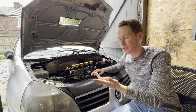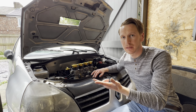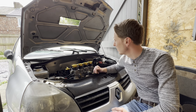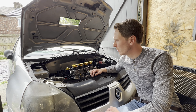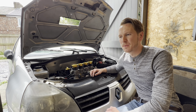So to recap: you've got a standalone ignition ECU. You want new spark plugs. New fuel injectors — ideally LPG, but if not then high flow. You don't have to have individual throttle bodies, but it is ideal. Oil catch can — ideal, because you're going to get oil contamination. And then finally, you want to change out your exhaust system.